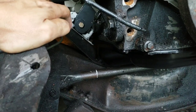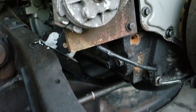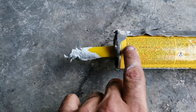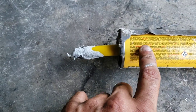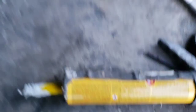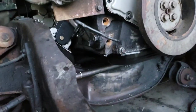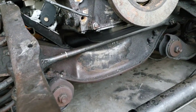All right, so now that's in there. I made sure I had a good squeeze through so we had a nice good injection of it on both sides of each motor mount, but I want to let it fully cure before I drop this motor back on top of it. Cure tack-free in five hours or less, full cure in seven days. Well, I guess we'll see you in seven days, I suppose.